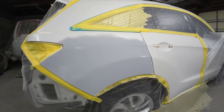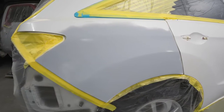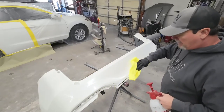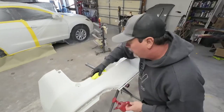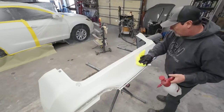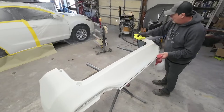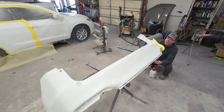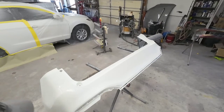This is the vehicle we'll be painting today. In previous episodes, we repaired and prepped this out for paint — it's masked off, finished sanded with 600 grit sandpaper and we're ready to spray. We're also painting the bumper. The first thing I'm going to do is wipe down both panels with isopropyl alcohol. You can use wax and grease remover or a water-based cleaner. I like to use a brand new microfiber towel because it cleans a little bit better and doesn't leave any lint behind.